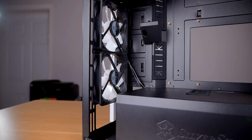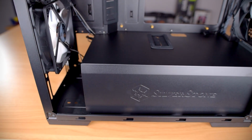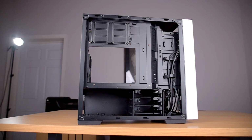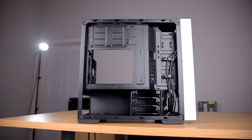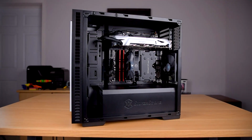They included 2 large grommeted holes by the motherboard power and SATA connectors, a large grommeted and small ungrommeted hole in the power supply shroud, and plenty of cable tie-down points on the backside. Those front 2 grommeted holes are also angled, so it's easy to connect SATA cables to angled ports on the motherboard. The end result of cable management leads to a very clean look inside.